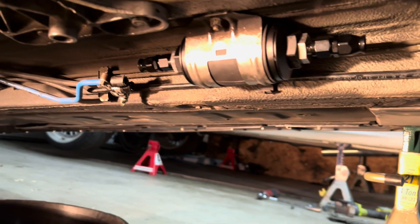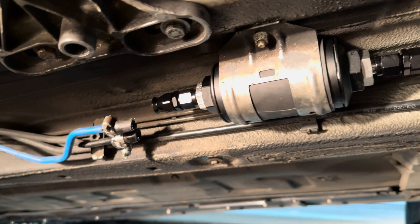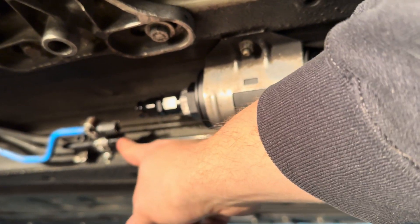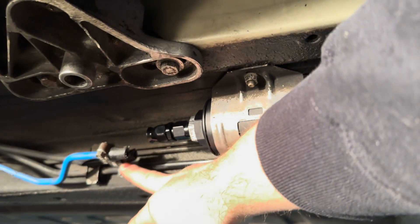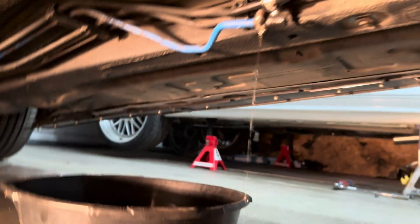The first line I'm going to make is the short one from the feed into the filter, so I'll get to use one of those cool little fittings that converts the stock hard line to 6AN — oh, we're leaking. Oops.